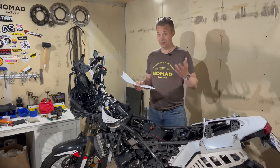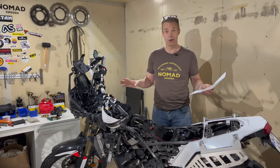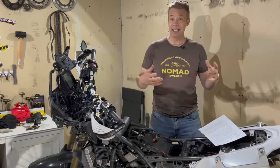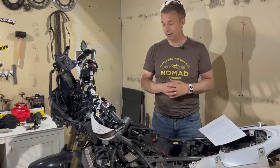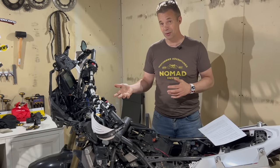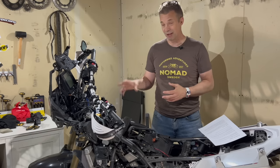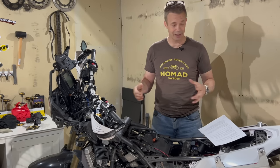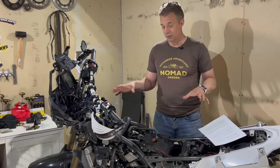There's quite a lot to go through, so it will be a lengthy video for sure. So let's start with the health journal of this bike. And when it comes to the maintenance, let's start off with the scheduled services. I let an authorized dealer do all of that. That's the complete checkups of the bike, and they do the things I don't want to do, like the scheduled 20,000 kilometer spark plug change, 40,000 kilometer valve checks and everything, and also the diagnostics, because they can detect if there are some sensors or whatever that are failing. So that's good, I let them do that.